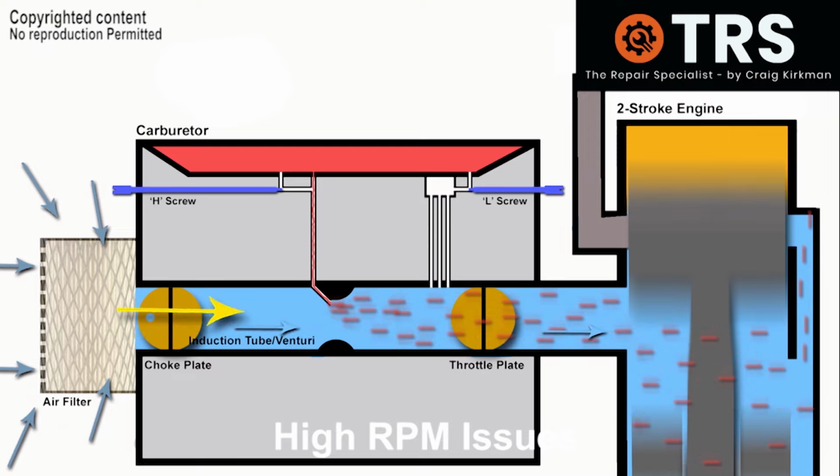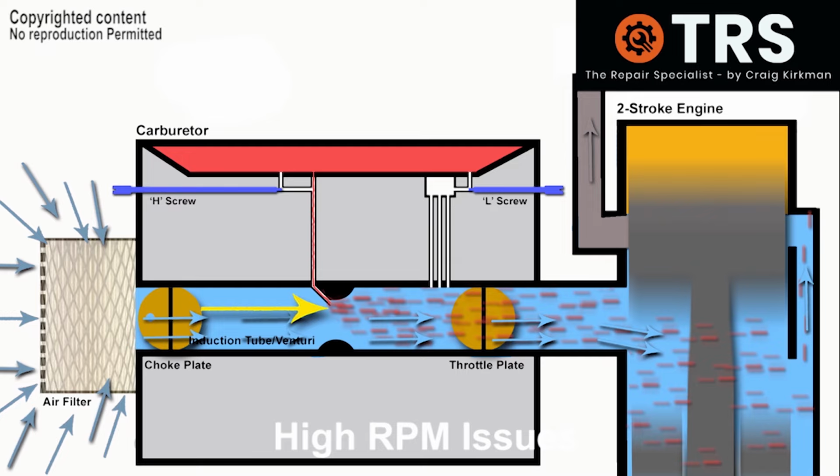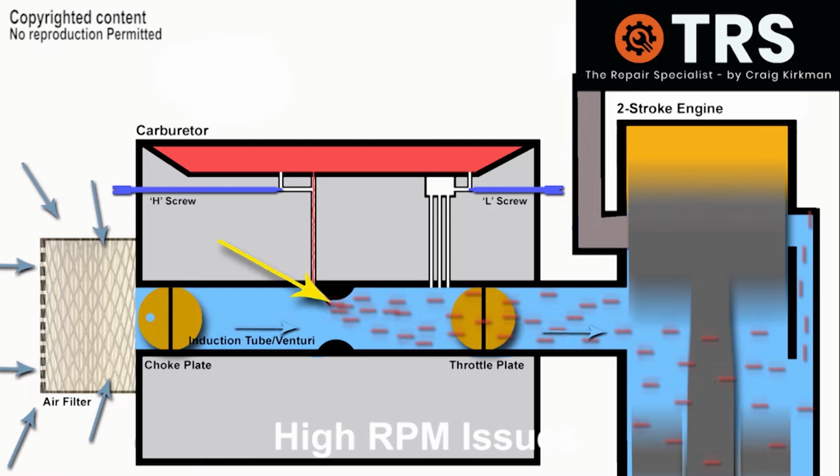So it's a knock-on effect. We need the air to draw out the fuel, but if the fuel is restricted in some way, then the fuel is going to prevent the engine from running at a maximum, and therefore prevent maximum intake of air. So in a nutshell, whether this throttle plate is either open or closed, there's only the same amount of fuel going into the engine that's sufficient for idling only.